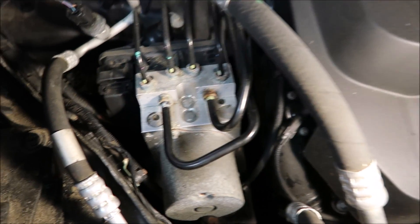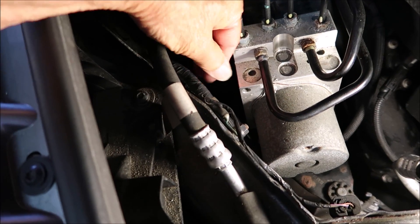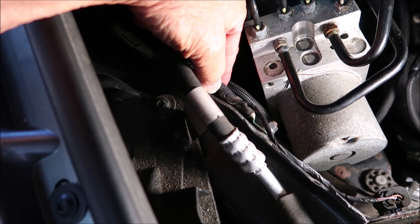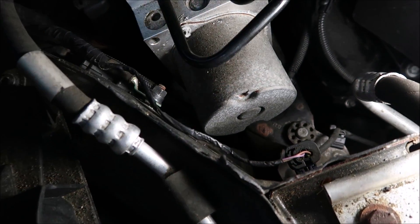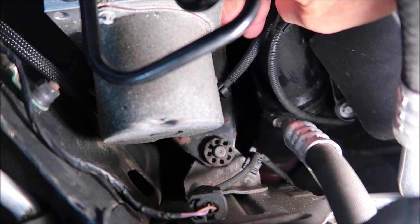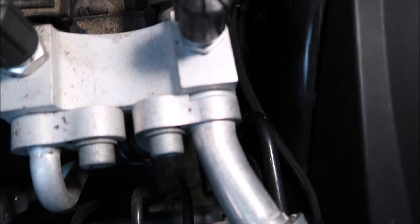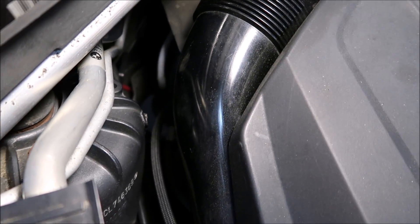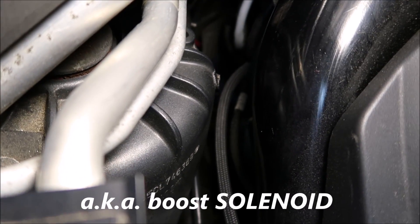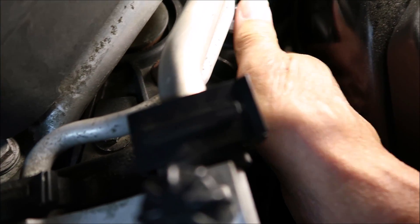And this is what I did to fix mine. If you look just to the left of the ABS booster pump here, there's a braided hose right here. This is a vac line sitting inside of a nylon braided hose. It runs under the pump, along the side of the engine, and then into the boost control module.